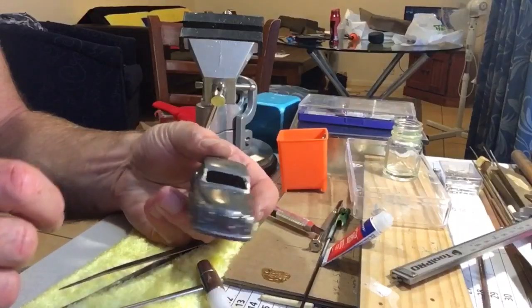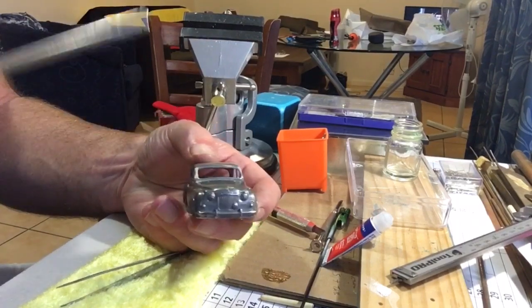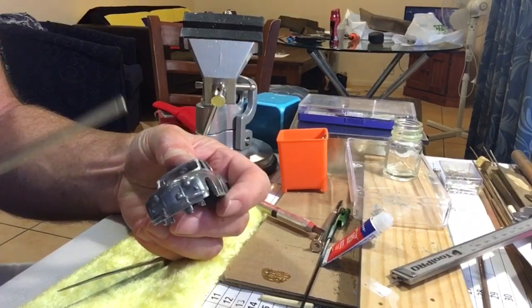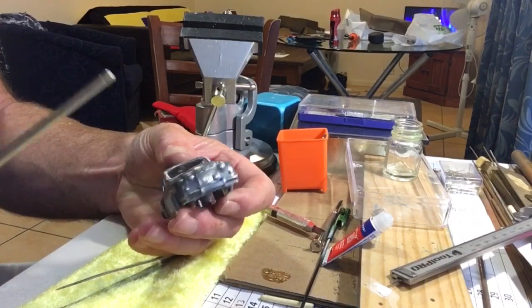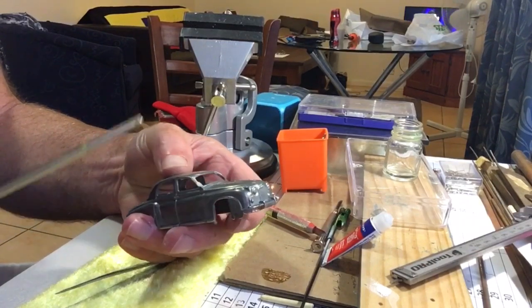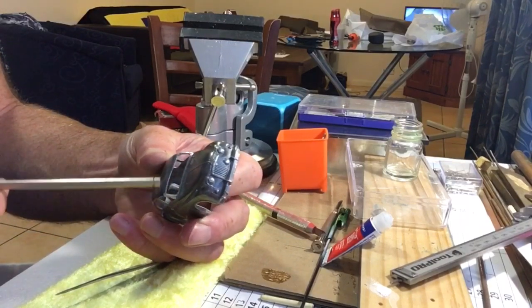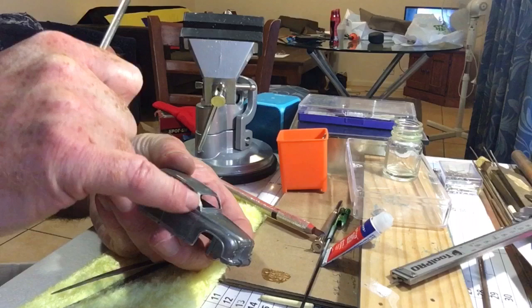Bit more work. Okay, my pet peeve is people that use cotter pins, which, you know, they're great, but they're great as a basis for a pillar repair, because as you know, cotter pins have a domed side and a flat side, and yeah, A-pillars can have a flat side. It's generally on the inside, of course, and the outside can be domed, but more often than not they have a trim line, whether it's for the windscreen molding or the drip rail that runs along the top of a lot of cars and down the A-pillar.